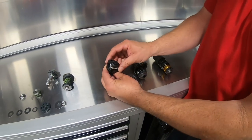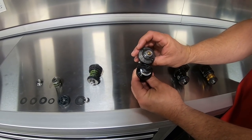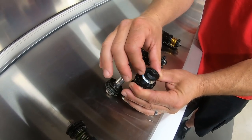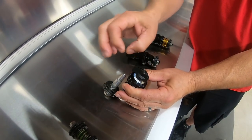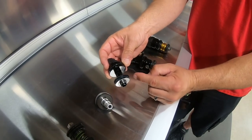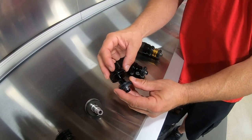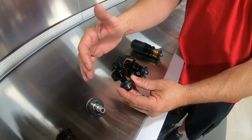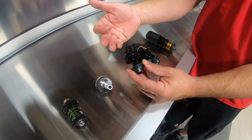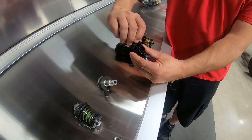Here is a three-way adjuster — a simpler version of the dual speed. This is high speed only and you have three positions: soft, medium, and hard. It's essentially the same adjuster — piston and valving, it will pop off on rebound — but it doesn't have the detail of adjustments that the dual speed does. It doesn't have separate high and low speed adjustment. It's basically just turning compression up and down, allowing flow through the center shaft and out of the ports.